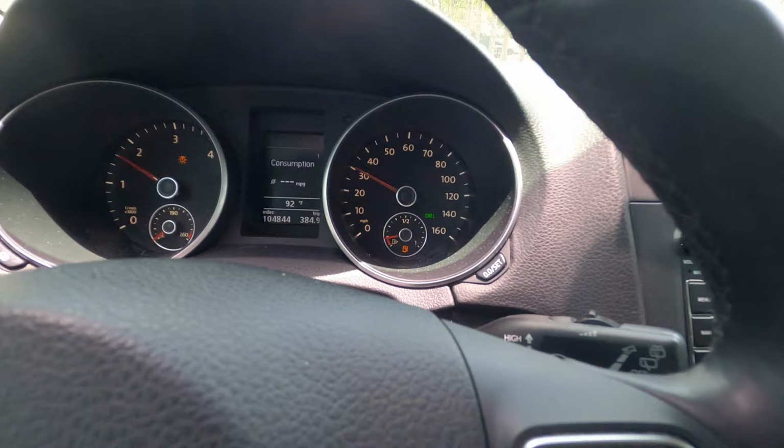I guess this is also a good opportunity to talk about something else that was acting up. I believe as part of the wheel speed sensor that we just changed out, the transmission was occasionally doing weird stuff. At one point we had the little service icon instead of the gear indicator light on the dashboard. Turned the car off, turned it back on, and that had gone away. And then more recently it's been basically hunting for gears. Be driving along and out of nowhere it will just downshift into a lower gear and won't automatically shift back.